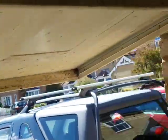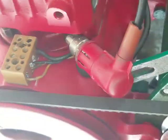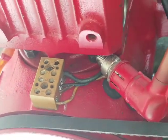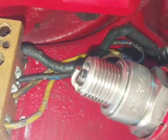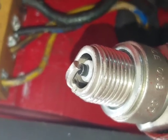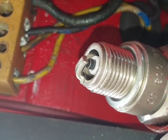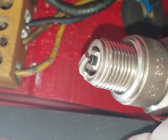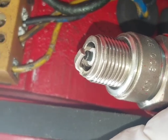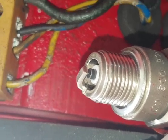I've just pulled the garage door down a little bit to make it darker. If you've got all the curtains open and the cockpit covers off, you may not be able to see the magneto strength spark. It's a brand new spark plug, so it was doing exactly what I expected — having the spark only between the central electrode and the bent tip. What you don't want to see is a spark going around the circumference rather than just on the bent tip, or an orange colour which means weak.